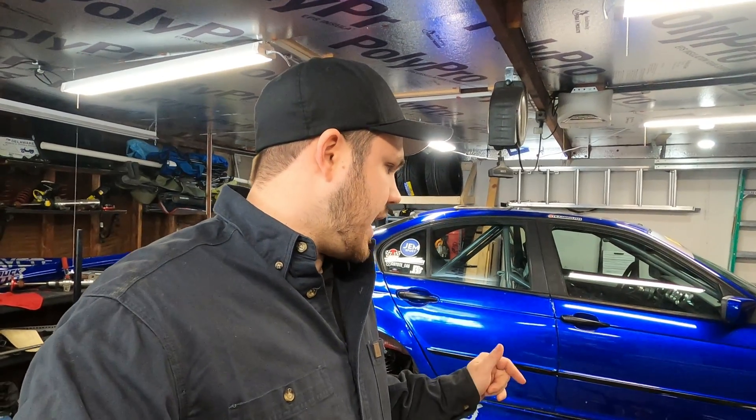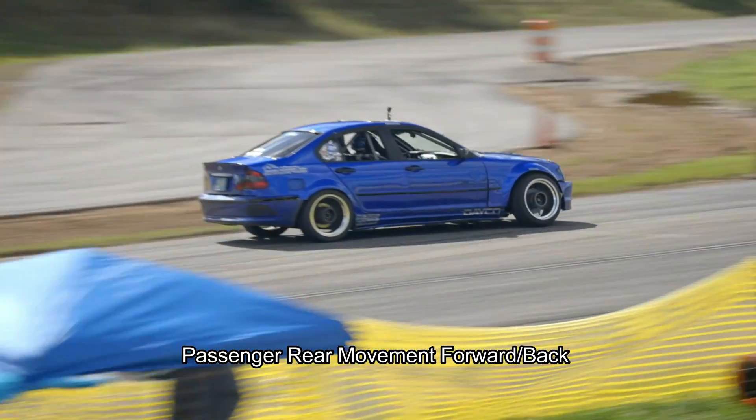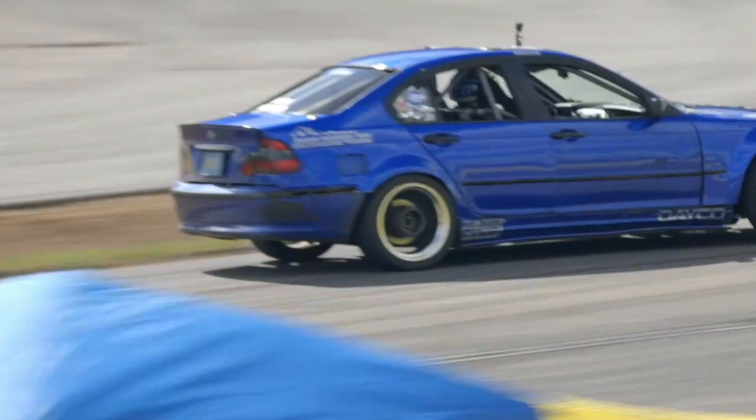So it's finally time to get started on the car. I have the fuel tank out already and I'm going to be welding up some parts of the chassis that got a little rusted, and putting some reinforcement plates in. The passenger side rear trailing arm pocket is basically three bolts, but it's a stamped piece that's welded into the frame with some spot welds and sealant. Some of those came out at one of the Riverside events and the rear trailing arm was basically barely held in, which I didn't realize until the end of the event. I've already reinforced it partially, but now that I've dropped the fuel tank I can go all the way in around the rest of the chassis to double check it's all good to go.